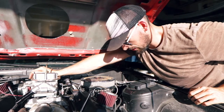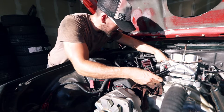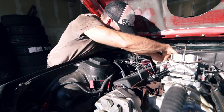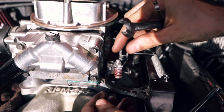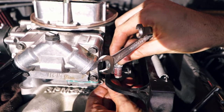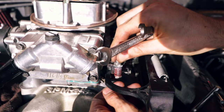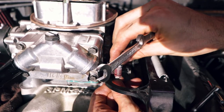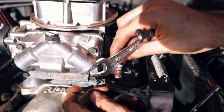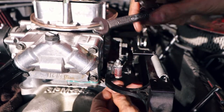I love the fact that I got these AN lines in here because they make this whole thing so much easier and cleaner when it comes to setting this thing up. When we're looking at this, we're trying to eliminate the play right here - I can move this up and down before it actually sets on there. I need to get it to where there's no play but it's not pushing down. I need to eliminate that play first.